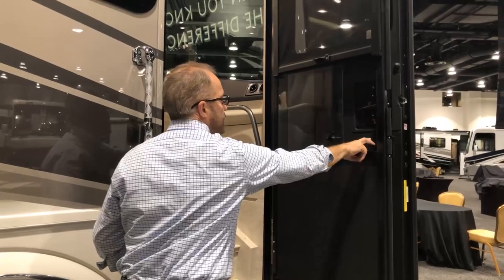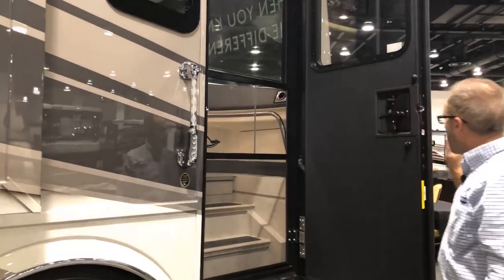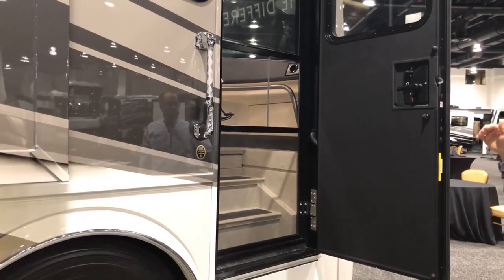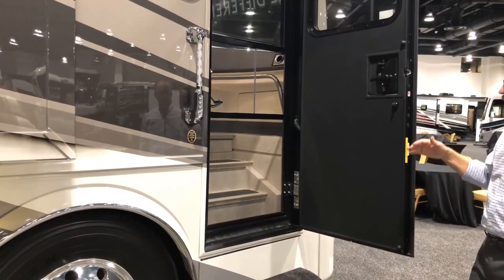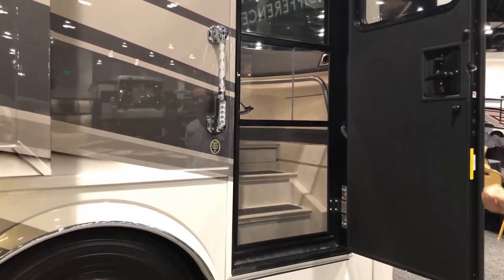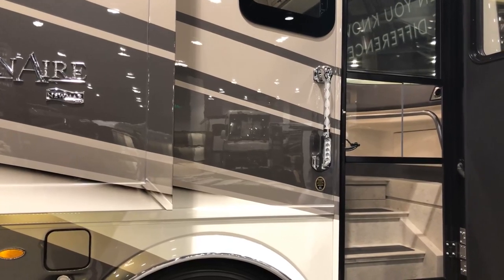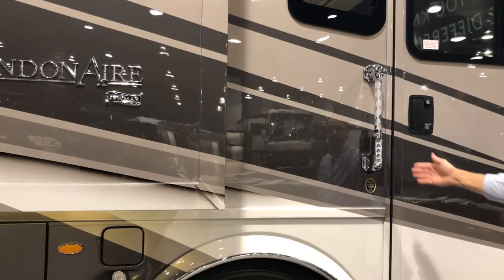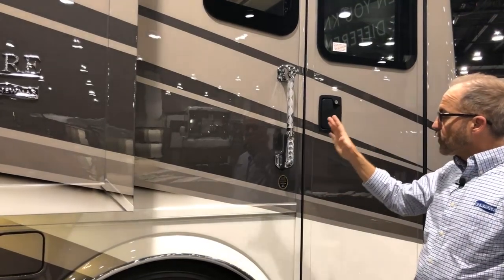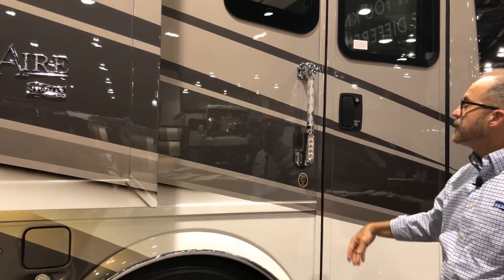You can also use this lever — push down — to close your screen door. When the door closes, the magnets send a signal for the steps to open and close. If you'd like the steps to remain open so they don't move every time you go in and out, there's a step override switch in the overhead. If you don't have your key fobs or keys, you can still lock and unlock your doors and baggage compartments with the trimark handle. The default code that comes with your coach to unlock your door is 1-2-3-4-4-4-4-1.